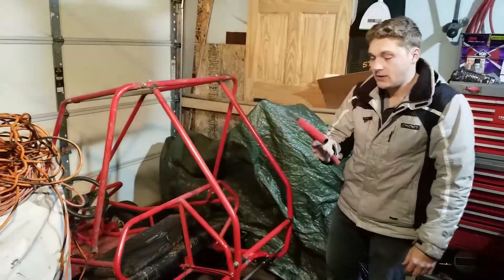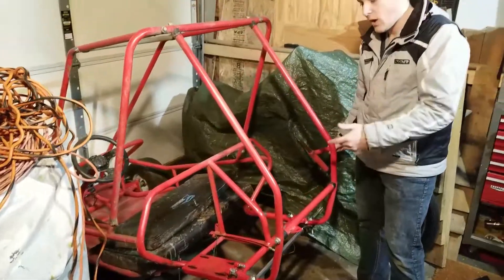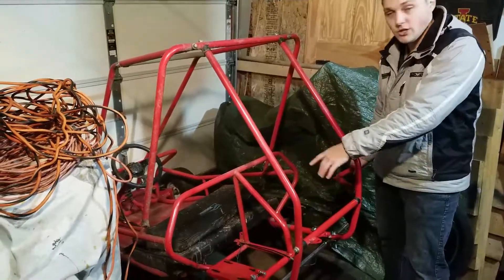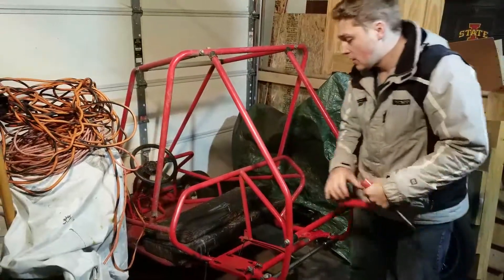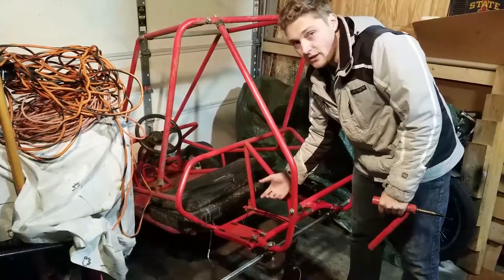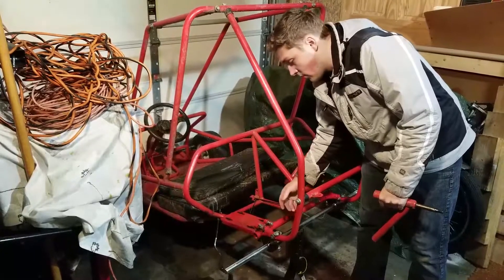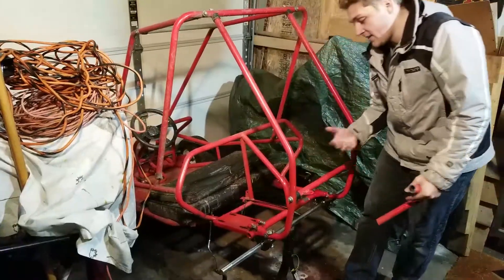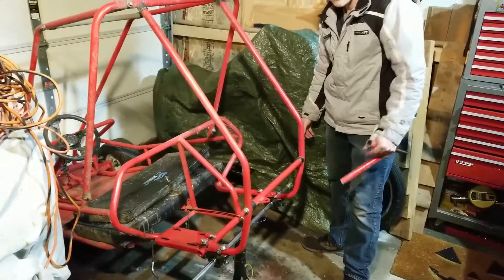You guys saw us cut off all the old parts and put in this axle assembly. In the next video we're going to swap in the drivetrain — sprockets, brakes, and the engine with clutch — and see if it works. We kept the stock engine mounting because the slotting lets you make up for any slack in the chain. We're still waiting on wheels, so those will come much later. Next video, we might see this thing running and this axle finally spinning under its own power. See you guys in the next video.